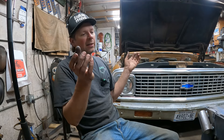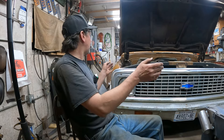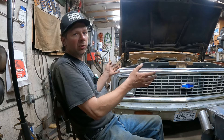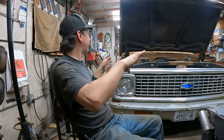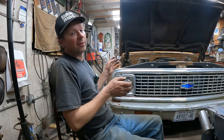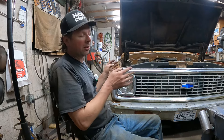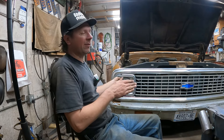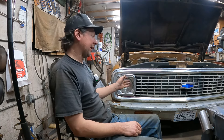When this truck is disassembled — looking underneath the cab, it does need the cab mounts, front and rear. So I'll probably strip all the front sheet metal off, take the doors and stuff off, get the cab, do the cab mounts first, then work on the rocker panels, refit the doors to the rockers. The frame is scaly — not real bad. The front suspension — I'm changing the springs, shocks, and uprights to put the lowering kit on it, front and rear, all new springs. I'm looking at the front control arms — they're kind of scaly, and the ball joints are used.